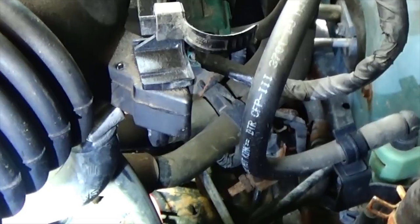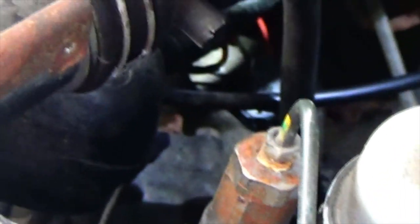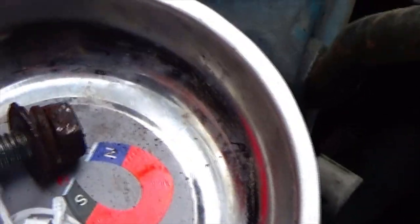You want to work on a cold engine. I just went to disconnect the wiring harness — that gray adapter with the red wire and the black wire on the left — and I noticed that black wire is dangling, so that might actually be my problem. I got the 10 millimeter bolt loosened. Once I broke it free I used the 10 millimeter socket with the small extension, then took the ratchet off and used my finger to loosen it the rest of the way. The bolt has a couple of washers on it, so make sure you save those — we're going to reuse them.